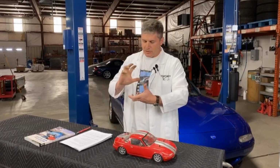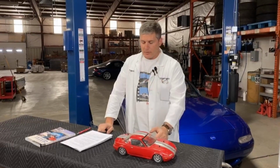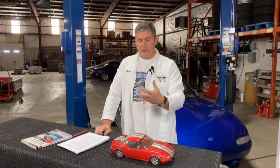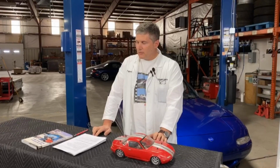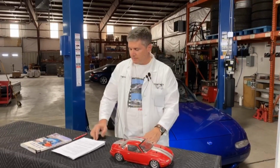There's a bunch of different ways that factories do parking brakes, but the mechanism to clamp those pads down is different on factory stuff. And it varies from car to car, so it's difficult to make generic, which is difficult for the aftermarket. So that's just the life we live in. If you don't want to deal with that parking brake problem, you're best to stay with stock calipers. Maybe you can paint them red or something because that'll make them faster.